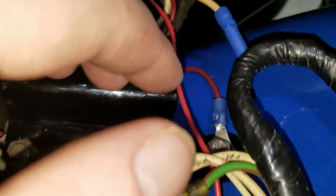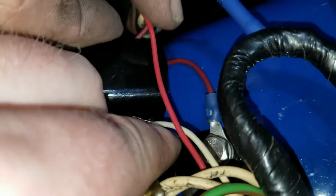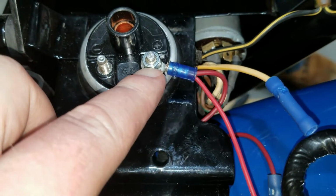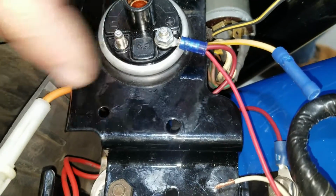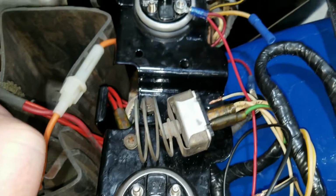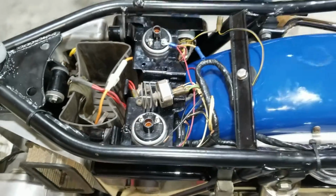Okay. So we backed this bolt out here, and we put a ground there. And the other part of that red wire comes from the box that's down there. It goes to the positive coil, on the right side. Now we need a jumper from this negative to the positive over here. So I'll work on making that. Stay tuned here.